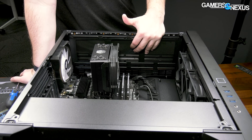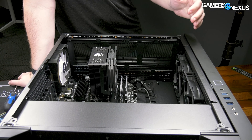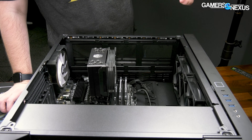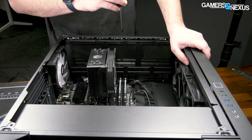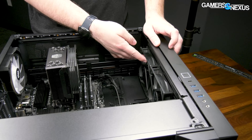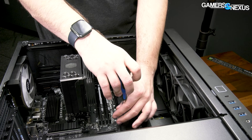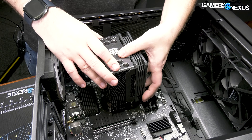The only reason this system will do okay thermally is because there's no exhaust at the top. If you buy this system and add exhaust fans up top, in most situations it's going to make it worse — we've shown that in case review benchmarks before. Just be aware: adding exhaust fans on top will screw up the pressure balance because these fans are already pulling air in from the top anyway. Any air coming in from there will just exit immediately when pulled through an exhaust. Don't add fans there as exhaust. Intake would do very well though, but you may want a dust filter.